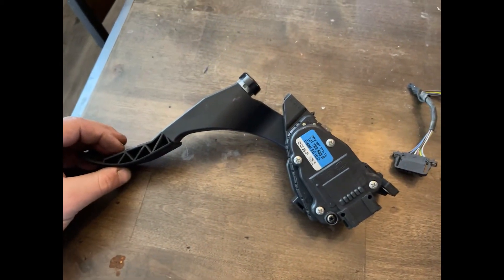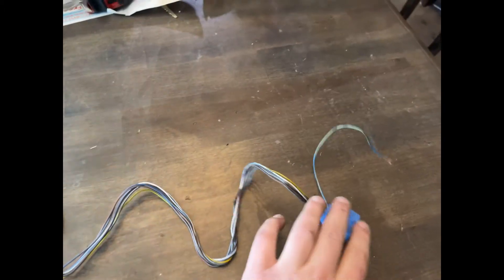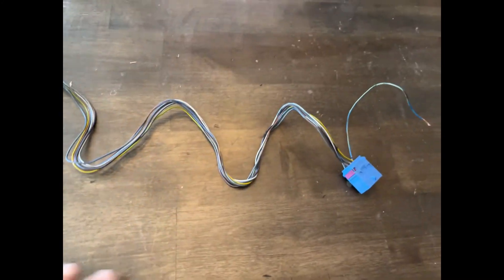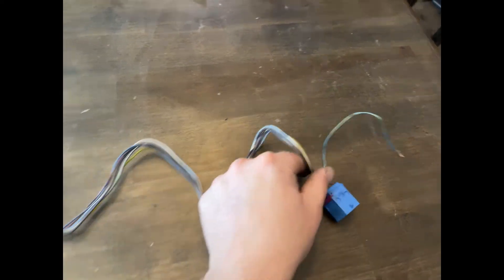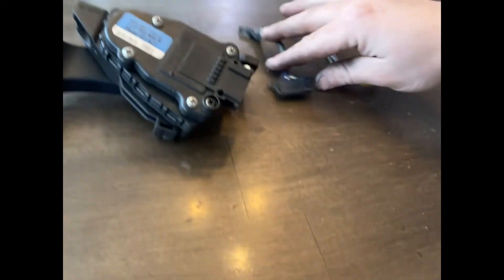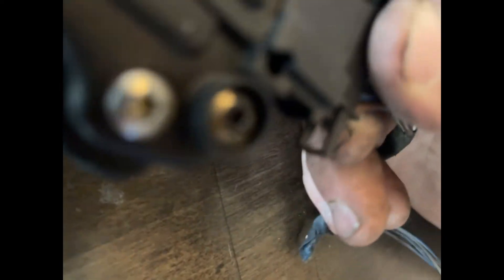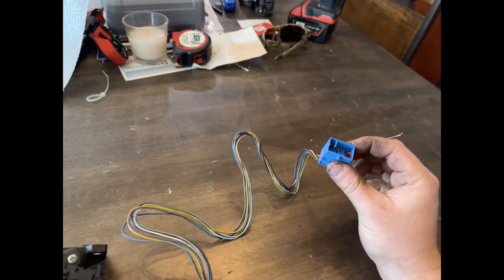Here is the foot pedal — this is the drive-by-wire ALH, so you need a pedal; it's one of the required systems. The entire harness is exclusively for the pedal — if you do a good job, you can pull it out without cutting anything. This connector plugs right into the foot pedal and connects to your blue connector on the main big harness.